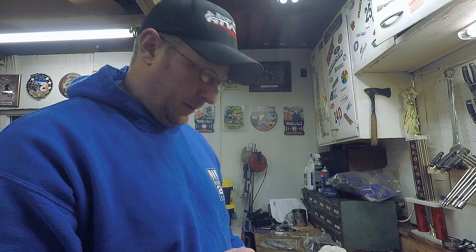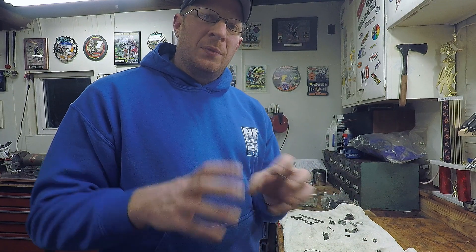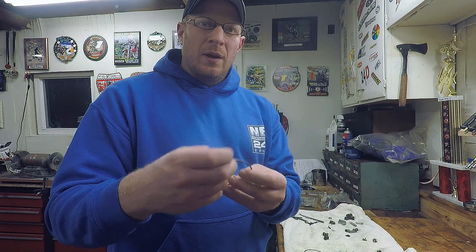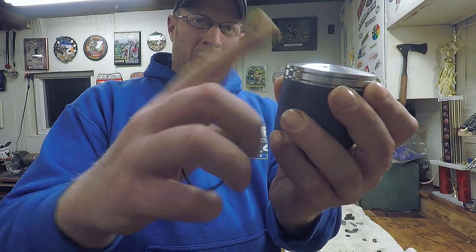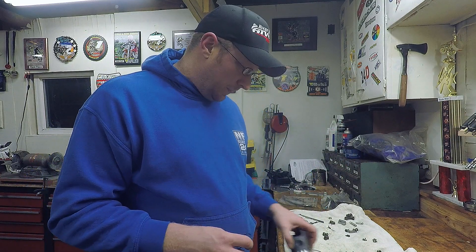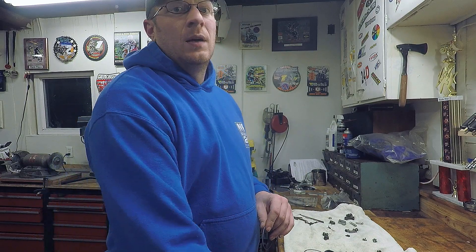It's important to check your piston ring end gap — the gap between the ring ends inside the cylinder. When these rings heat up they expand, and that gap is going to close in. If they actually touch, it causes a catastrophic failure: they expand into the cylinder walls, you'll wear out your cylinder, melt your piston, and the top will probably crack off. The ring seizes with nowhere to go. All you need is a set of feeler gauges, the service manual, and possibly a file.